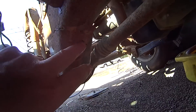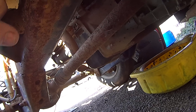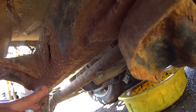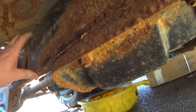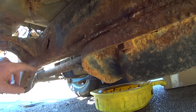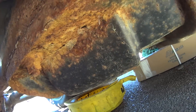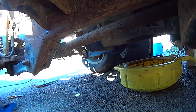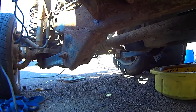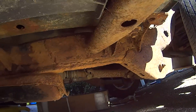Under the truck, one of the things that I noticed is, see this hole here? And there's a couple more. I need to really clean out this frame rail before I try to spray that Eastwood frame coating on it. These holes are clogged up and that will hasten the rusting of the frame itself. Now, there's no big holes in it like I've seen in a lot of the Wranglers, so we're going to go back with the needle descaler, the wire wheel, and just continue working backwards. Right at the top of it isn't too bad. Trying to clean this off as well as we can and then treat it for rust. Because I actually believe that we caught this in time before the frame rusted completely out.